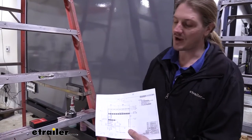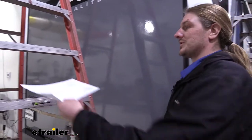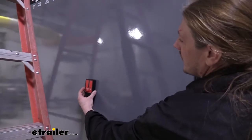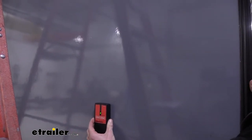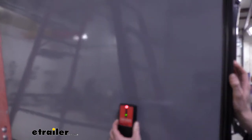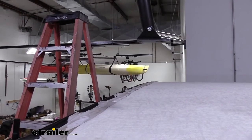At first glance I thought the pillars were on the driver's side, but reading further it says the schematic is viewed from the interior — so you'd be looking at it backwards. Our pillars are on this side. Another way to verify is with a stud finder. Cheaper stud finders likely won't detect anything on the wall, but with a decent one we can bring it over and detect a stud right here — exactly where the schematic shows. I just use pencil marks to note the stud locations.